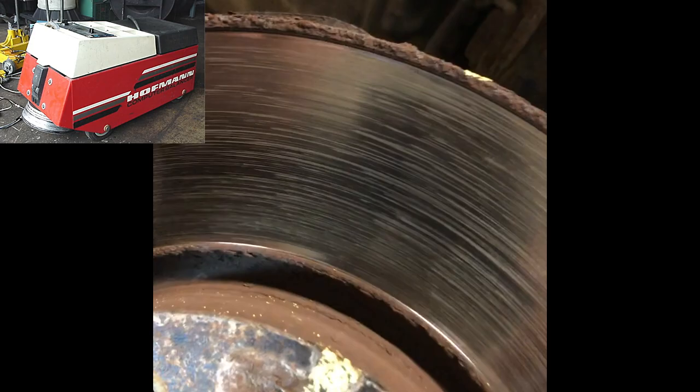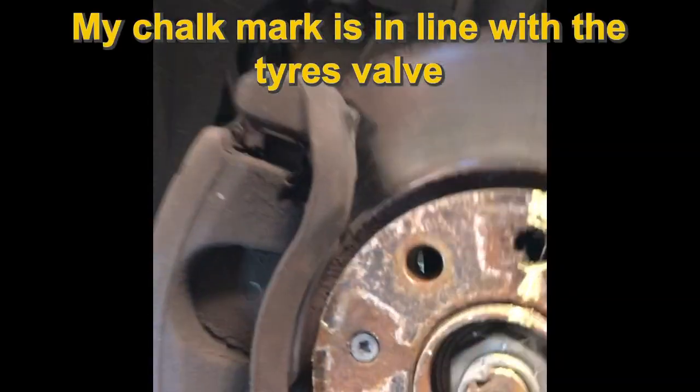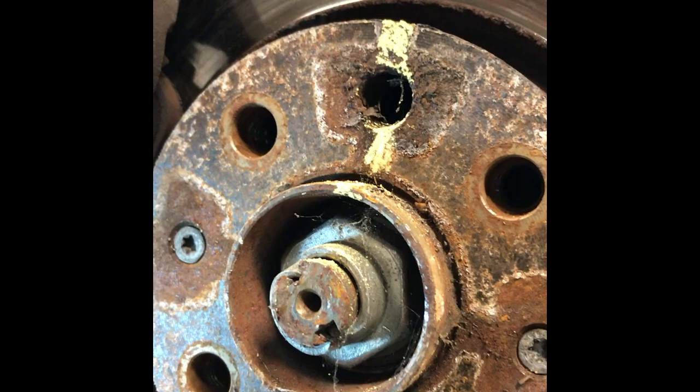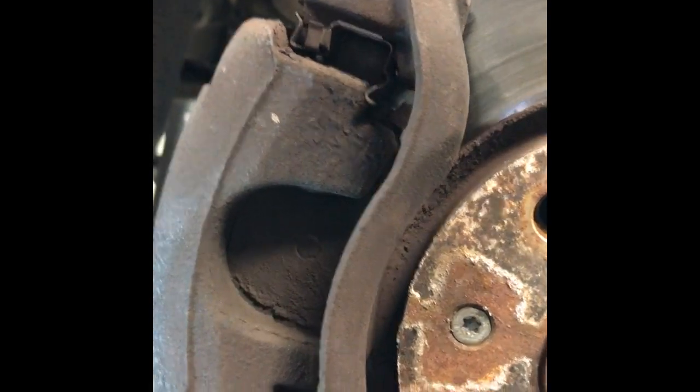Customers are complaining about wheel balancing issues, so it would always be fine. Even though tires get wheel balanced, some people like to have high speed balance, and that means the wheel gets balanced at a very high speed, normally on the car. So on the car balancing. It's a type of dynamic balancing.